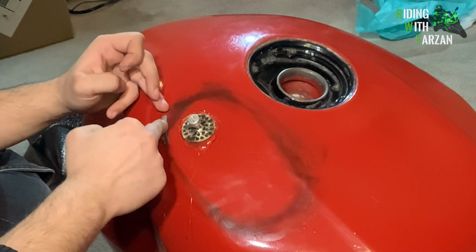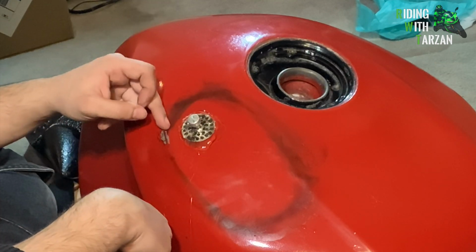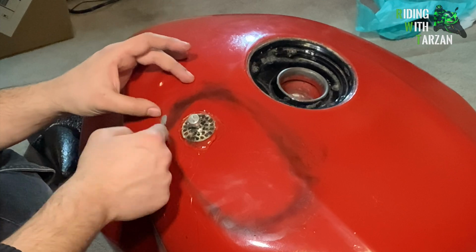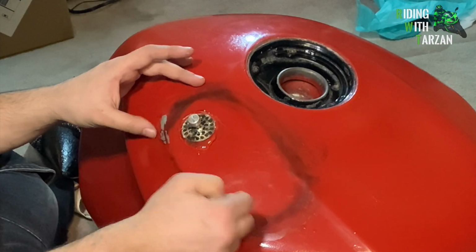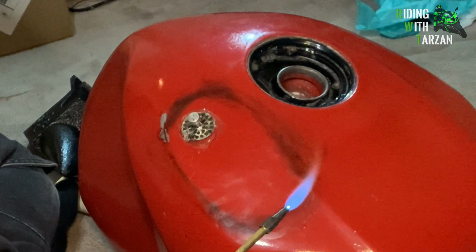Plus, if I pull this too much, I don't really care because this is already the paint shot on this. So I know from experience that this is where I want to be every time when I pull, and I know that the dent is deeper on this side, I will place my puller deeper on this side. All right, let's see what happens. A little bit.